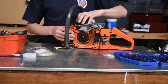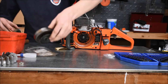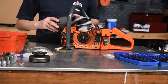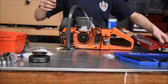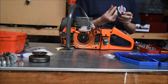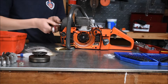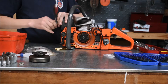So now we have the cylinder on and bolted on. We're going to go along and do the other parts — lightly on the sprocket, we can do those later. The muffler — when I was doing this one a muffler bolt decided to come off and the other one wanted to stay, so we're just going to have to work around that. Pretty much anything on these you can almost guarantee will be 8mm, 13mm, or 19mm, or if it's a Torx it's a T27 head.